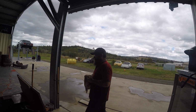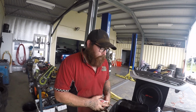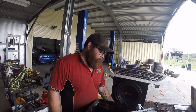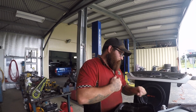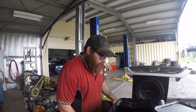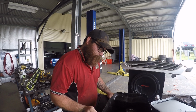So where do we go from here? The last motor was in there since 2011, and it's now 2021; it blew up in 2020. Trapnell built that one, and it lasted ages. The oil always came out pretty clean out of that car. And it was the oil pump that failed, not the engine. The oil pump fell off the block, otherwise it would still have had bearings in it. I saw on the internet the other day, in America, someone with a Melling high volume oil pump that cracked as well and fell off. So it still happens.